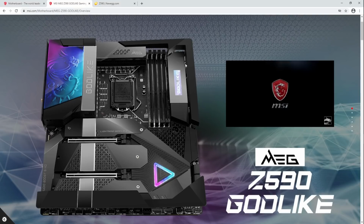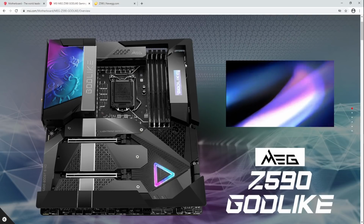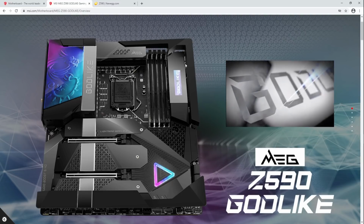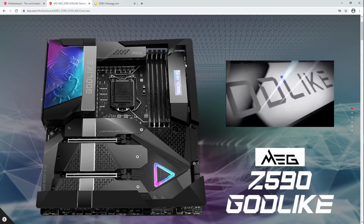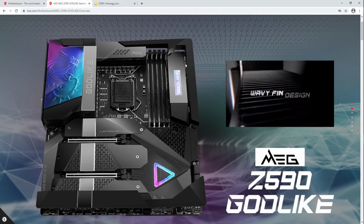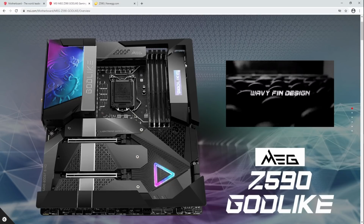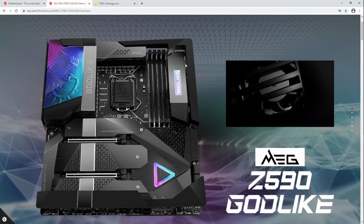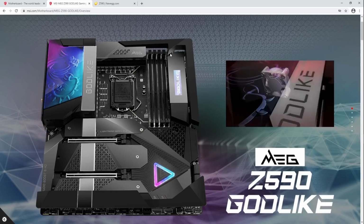I actually have a 5 gigahertz kit designed specifically for Intel CPUs. And the only way I can get that kit to even post is 1.7 volt system agent voltage. And I've only tried it on the Apex, and that's not okay. And it's not stable. It's not even remotely stable. It's just to get into the operating system at 5 gigahertz.